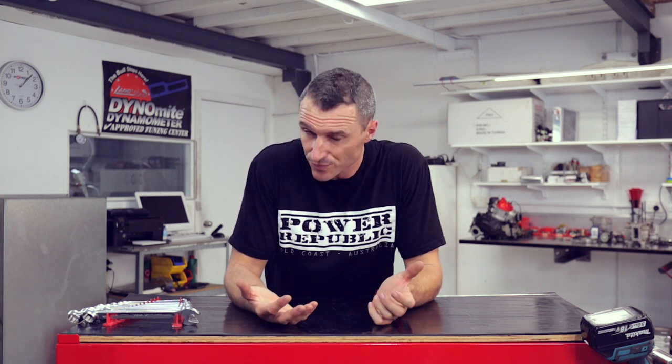The second part of question eight is about seats. The Tony Kart seats come in one standard rigidity but four different sizes. If you want a softer seat you can change brands to something like the Tillett VG hand-laid seat, which is pretty popular with Tony Karts — especially on Mojo rubber with Rotax engines. I've tried the soft seat in my category with the Dunlop DFM and I didn't go any faster or slower, so I don't bother since soft seats can crack if you stand on them. A softer seat makes the cart not as reactive onto the tyres because the seat flexes with the cart, whereas a harder seat makes the cart more rigid and should make it come on a little bit faster.